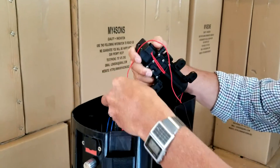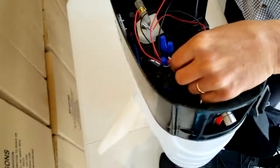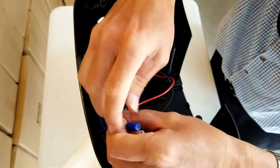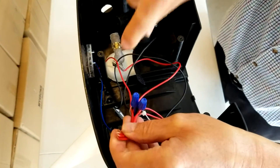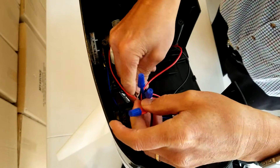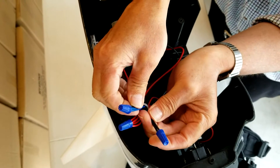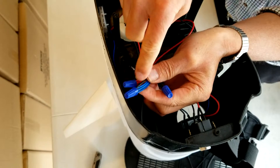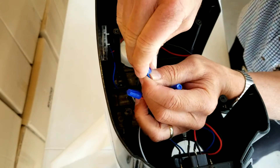The only thing left to do is undo the wires. The red wire from the motor goes to the main red bundle — you just undo that electrician's nut; it comes off real easy. It's good practice to screw it back on afterwards. The black wire is a bit more important to remember — the motor wire goes to the bundle with the three blue wires. It's the only black wire that goes into that bundle. Take that off and replace the nut to keep everything together.